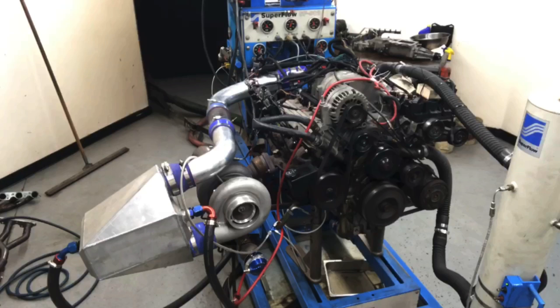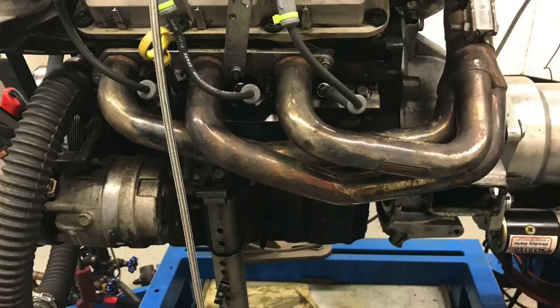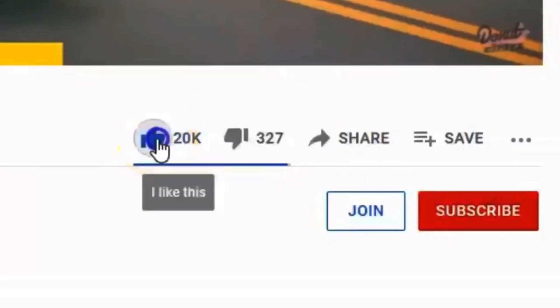What did we learn from adding our cheap eBay GT45 turbo to our L67 3800 supercharged V6? Turbos are awesome — which is exactly why I recommend them for almost everything. Add a turbo and all of a sudden you look like a hero. Sure, all the previous testing with different pulleys, ported heads, camshafts, and headers was great information, but sometimes you just want to make power — and that's exactly what a turbo does. We more than doubled the power output at one atmosphere of boost at 14.55 pounds, which is why you need to put a turbo on everything. I'm Richard Holden — like, share, subscribe, ring the bell. More 3800, LS, and all kinds of testing coming up.